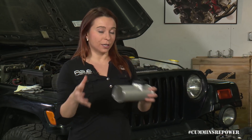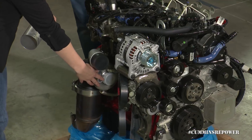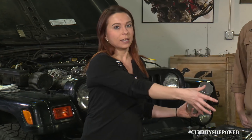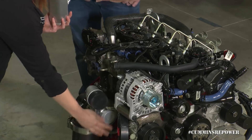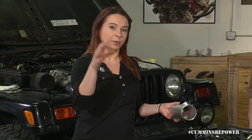This engine is a little bit different than your normal naturally aspirated gasoline engine in that it's turbocharged. When you're talking about your intake system, you really need to be getting your clean ambient air and routing it into your compressor inlet, which is actually on the exhaust side of the engine — a little bit different than just taking it straight into your intake. That compressor inlet is right here; you'll just take that cap off, and you as the installer are in charge of all the routing from your air filter down to that compressor inlet.